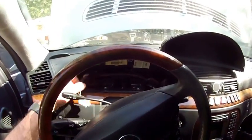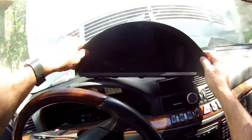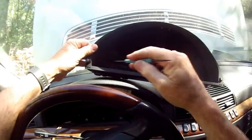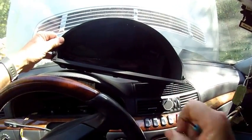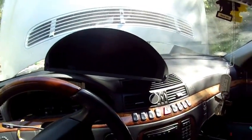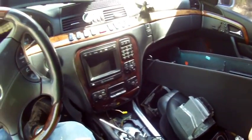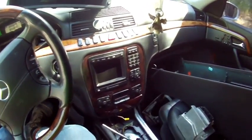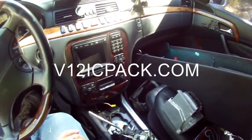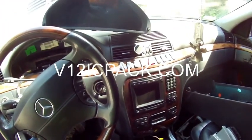If you're curious how the instrument clusters come out, you can get little keys on eBay - they're like six bucks - they just slide in here and here, lock in position, and you can pull the thing out and unplug it. Simple to do if you've got to get your instrument cluster out. And of course if you've got any issues with your ignition system not firing properly - coil packs, voltage transformer - I can certainly help you out with rebuilding or replacing those items. Thanks for watching.